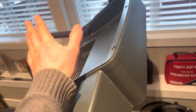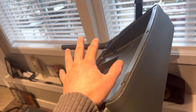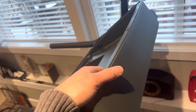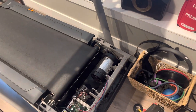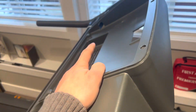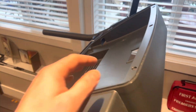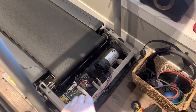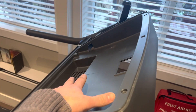Let's say you have your screen up here and you go to click the buttons and it's just bouncing back between two readings — not because you're pressing the buttons, it's just not responding, or maybe only one side is responding. You might think the motor is shot, but usually what happens is you'll hit a button and if it shows the speed is going but the treadmill isn't actually moving, that's a motor issue or a motor controller issue.